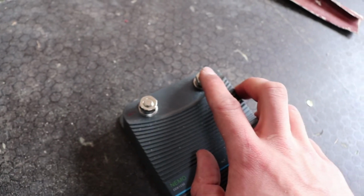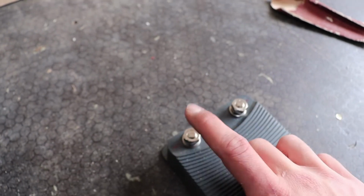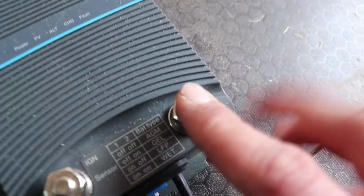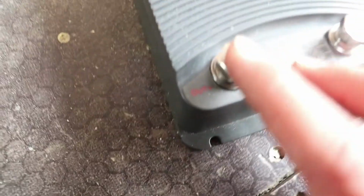This one here is if you have a solar panel, so they're the 2 sources of power. I'm only using the starter battery for now, so it charges as I'm driving. Here look, you've got the negative. This is just the ground to ground the system. Here is the live to your leisure battery, auxiliary battery. That's pretty easy, we'll just run that from here to the battery here.